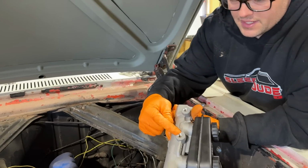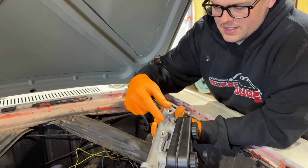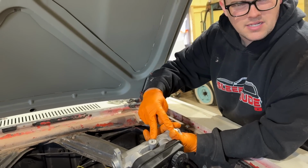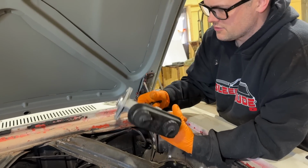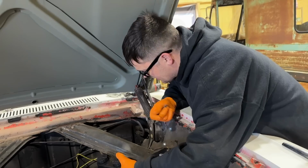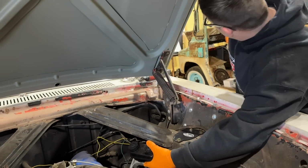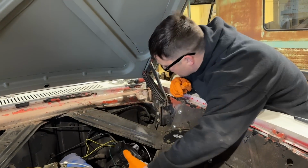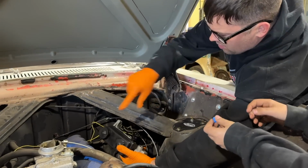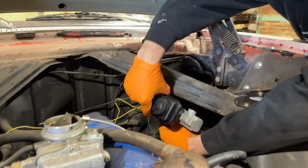So these have a standard 3/8-24 thread in here for a 3/16 line. So it's just your standard tube that goes in there. A lot of times master cylinders have weird sizes on these right here. It has the same width and everything, so it should bolt right up to this. It's the same one we put on a bunch of vehicles, like the Metromite has this one, so does the F100. We put it on our 67 Thunderbird we used to have. This bar, I wish it was like the Mustang, but this bar comes out.